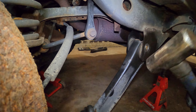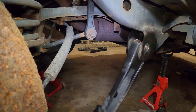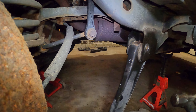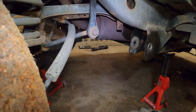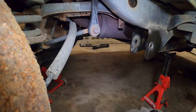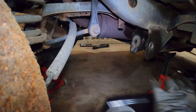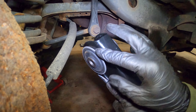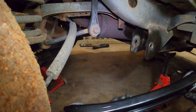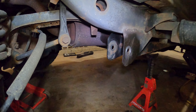You can see how stuck it is in there. I just don't want to shoot the bolts across the garage. Look at that - got it. Like I said, it is possible without cutting the whole thing up. You can see how it just pushed out. Those bushings are just completely shot - there's a steel sleeve in there that it gets locked into, but it just gets rusted up. You just got to knock it all loose.